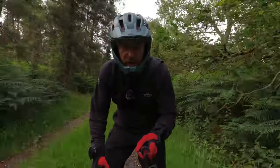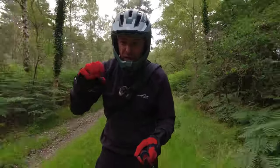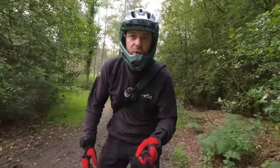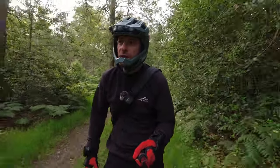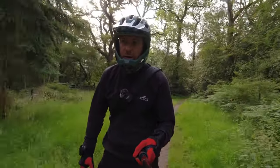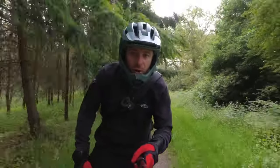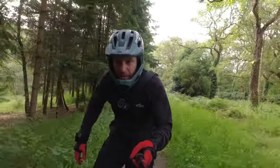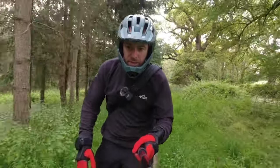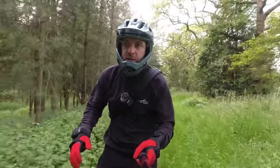It's all good. So yeah, as I was saying, you know, the tires has been good. I like the profile of the tire. I also like the softness of the tire. It really makes the ride pretty smooth. I'm running it at, I think, 31 PSI. And that's been perfect. It's been really good. A lot of guys say you can run it higher. That's perfectly fine. But for my type of riding that I do, that's a really, really good pressure. Now, again, I'm a 75 kilogram rider, just so you know. Probably about, yeah, just under 80.